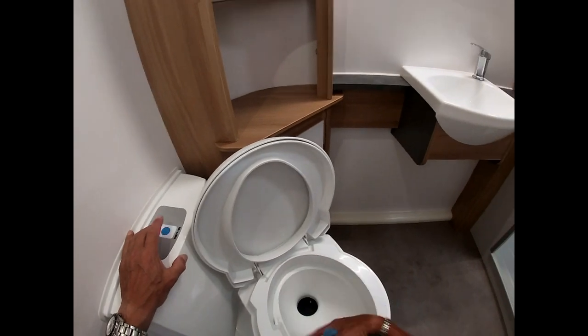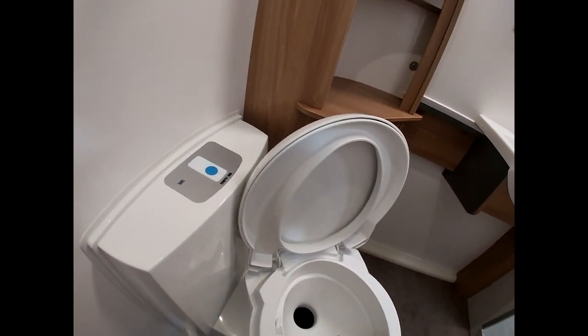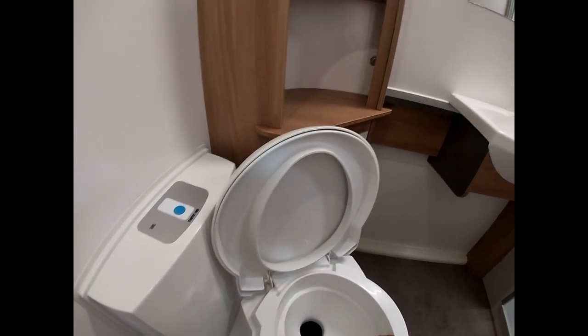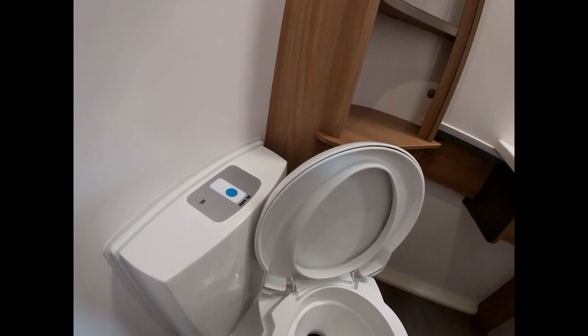You go to the toilet as normal, press the flush, water will come out through there, flush away through, and once you're done, grey lever on the side, pulled away from you, allows all your contents that you put into there to drain down into the bottom of the toilet. Once you're done, always remember to close that,